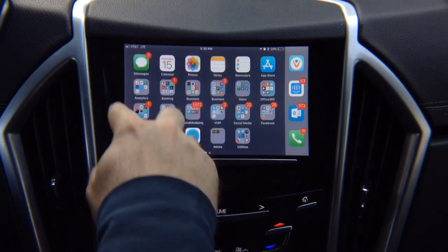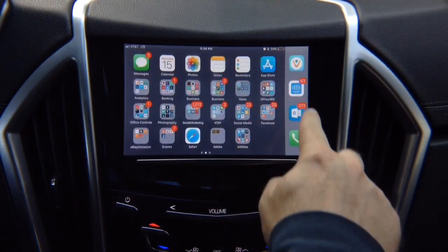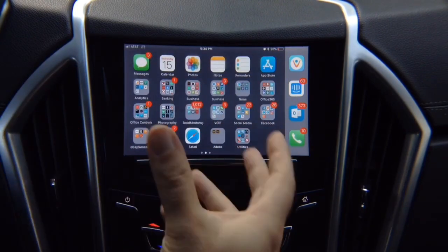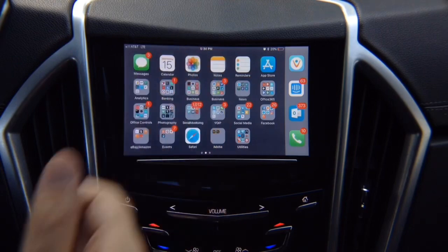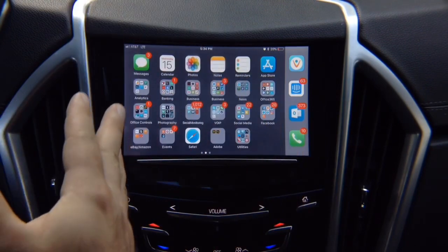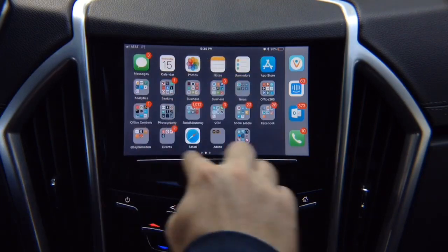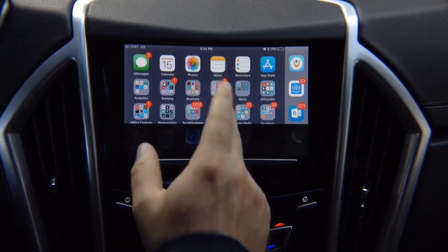If when you open the screen you feel like your image is stretched out, just press one more time to re-enter it. You can mirror iPhone or Android — iPhone through HDMI is recommended. In the car, it's easy to have it sitting in your armrest. If your Android doesn't have HDMI or Type-C USB to HDMI, you will have to use a wireless adapter. But this is mirroring, which means no controls from the screen — all controls are from your iPhone or Android. To exit out of the screen, press here. No limitations on mirroring.